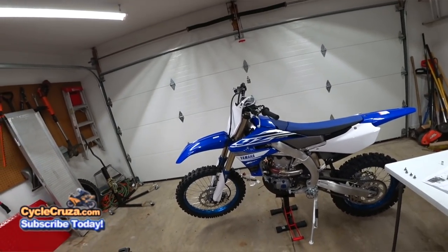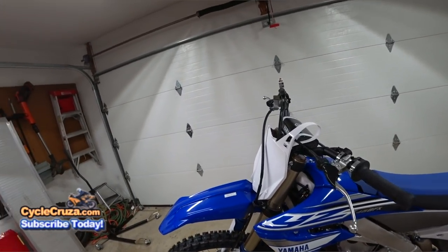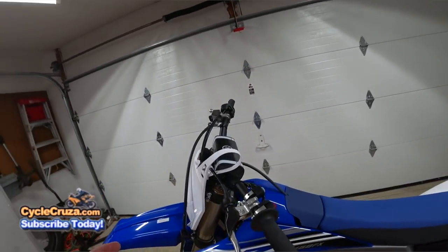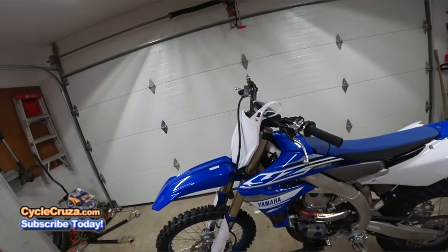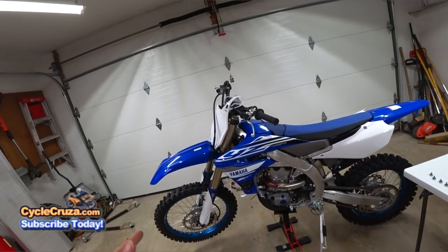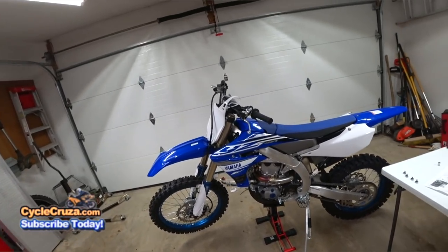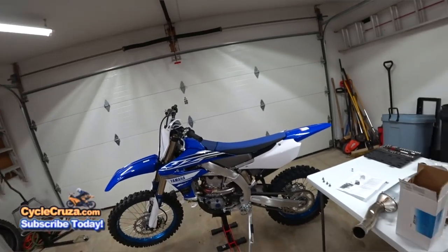As far as a headlight, I'm still waiting on that — it's going to be a really powerful LED light that'll peek through a cutout. The speedometer should be coming soon too, giving me temp, RPMs, and everything. The supermoto wheels will be here next week — I just ordered some Shinko 705s, which are 80/20 tires. I'll be making those supermoto wheels tubeless, taking you through applying 3M extreme tape, removing bubbles, and putting the tires and wheels on the bike.